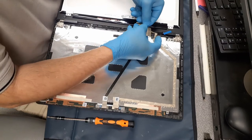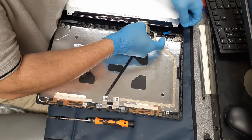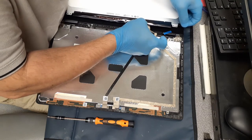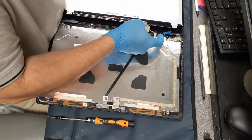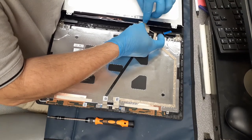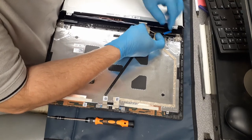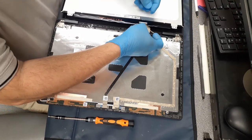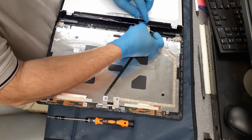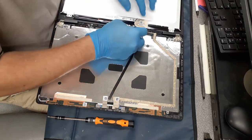When you're trying to plug this back into the new LCD, you need to be careful of this area where it plugs in. This whole section where the black tape is is all electronic components, and they are rather sensitive, so make sure that you don't squish it or bend it in any way. We'll fold that little wire clip down. Now we're using the foam tape, which helps to hold that wire clip down, and since it sticks up a little bit, when the other pieces of tape fold over top of it, they push down on that wire clip to help hold it in place.